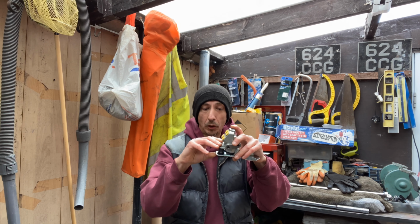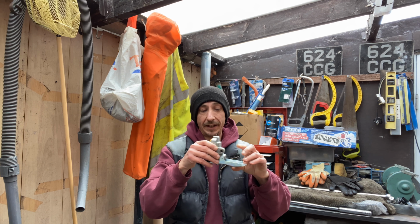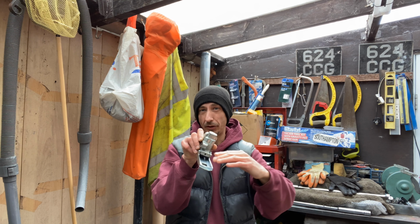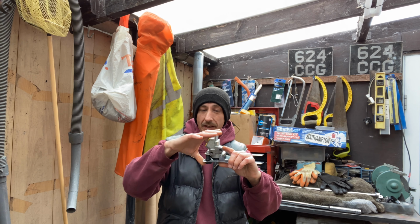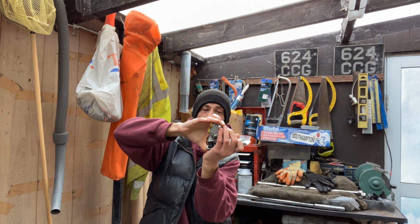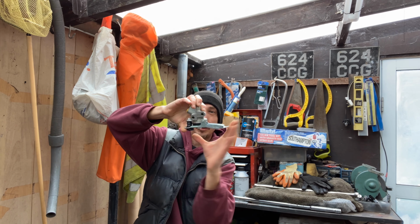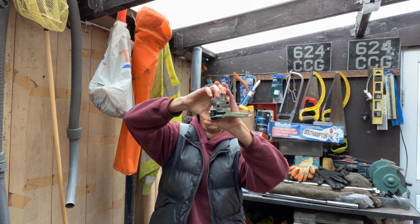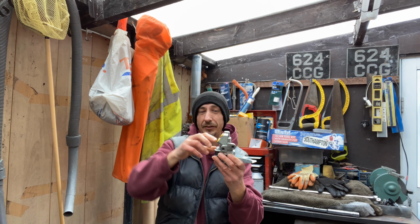So this valve will open and close in here depending on how much weight is in your van, and that's adjusted by some springs, there's a bar that runs across here, and then there's some springs. We'll have a look at that when we get out there, but basically this opens and closes a little valve inside. I mean, it's quite stiff, it's quite hard to move. I can't really hold it still enough to show you, but yeah, you can see that opens and closes the valve inside.